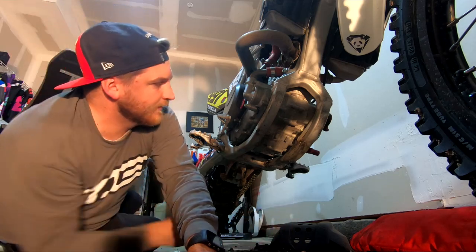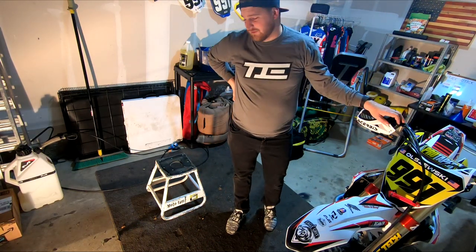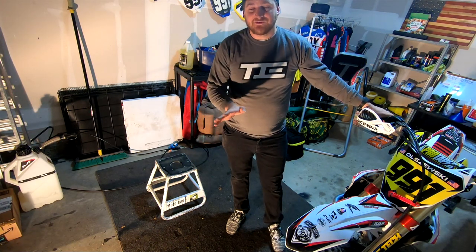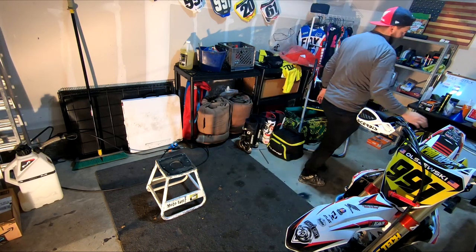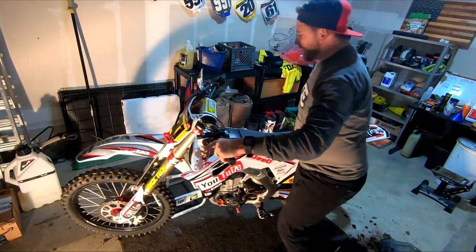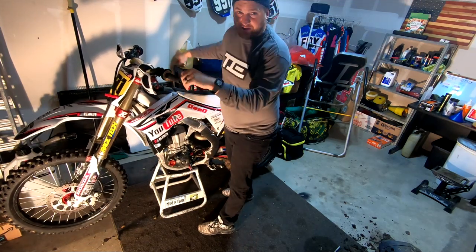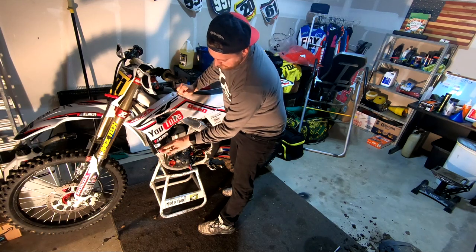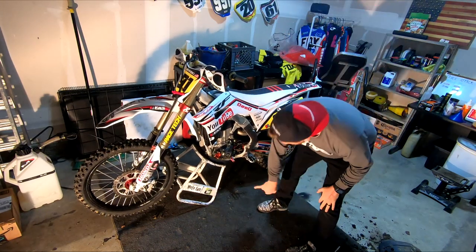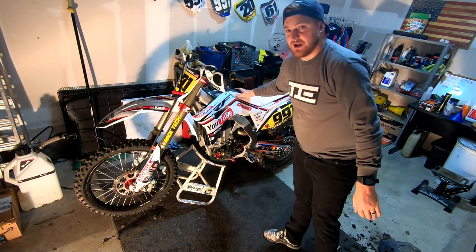Let me show you guys something really cool. I actually saw this on Facebook of all places. For as vocal as YouTube is whenever you do something wrong or some way someone else doesn't do it, I've never seen this shown before, but it's a pretty cool trick. So you can first see this is not my normal stand, it's my older stand. We'll lift the bike up onto it just like normal. And now we're going to actually pull the bike backwards and the stand is going to flick up and catch the tire and hold it straight up. So there you go - bike is held in place. Should still be able to get to the drain bolt. Might need to navigate it a little bit, but the bike is held up and you can access the bottom of it. Never seen that done before.